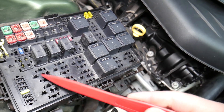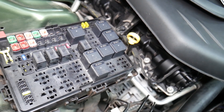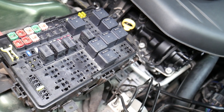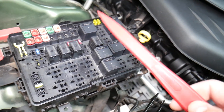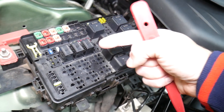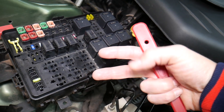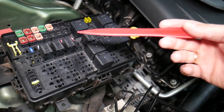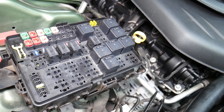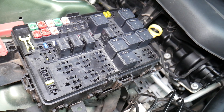For some certain fuses, it's important to disconnect the car battery when removing them. Otherwise, you can burn the electronics. For instance, when working on airbag fuses or anything like that, you need to wait at least one hour after disconnecting the car battery. And if you're not qualified and certified to work on the airbag system, I will never recommend you do that. Also, when disconnecting the car battery, it's a common mistake — it's important to know which battery terminal you disconnect and reconnect first. If you do it the wrong way, you can burn electronics modules. We actually burned the traction control module on a BMW that cost $2,000. We'll put a link in the description below on which battery terminal to disconnect first — check it out for your convenience.